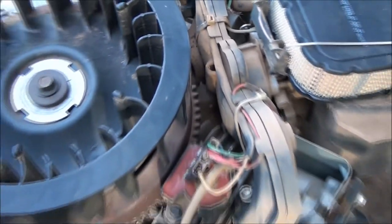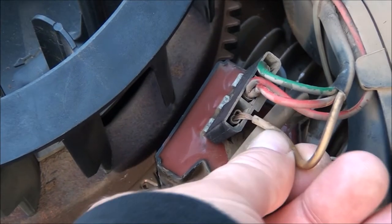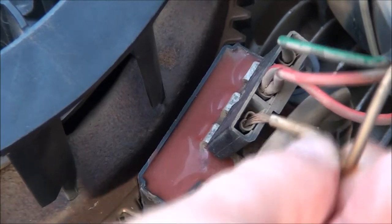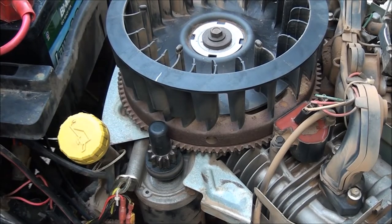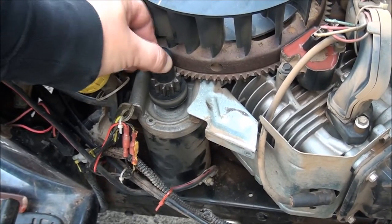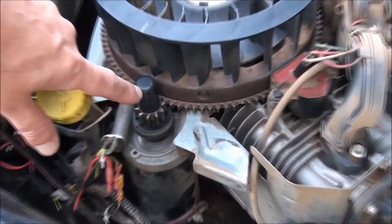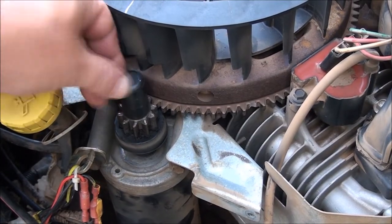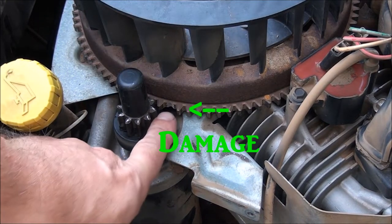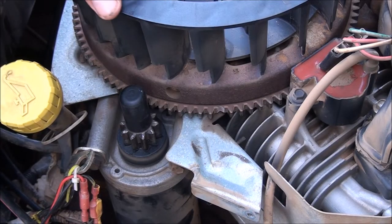You have some more fine workmanship on this side — they left about a half inch of wire hanging out. You can see the starter gear is about to fall off — not good. Luckily the ring gear hasn't been damaged yet from that gear flopping around. Oh wait, there is damage — brutal. Yeah, he's missing teeth already on his flywheel. That is not good.